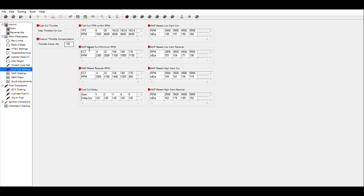Our fuel cut settings — we're going to change this from 100 to zero. What happens is when you lift your foot off the gas pedal, sometimes the car keeps it at an RPM for a certain amount of time before cutting the fuel. We're going to change that to zero so it gets a nice clean cut. We're also going to change the timing — this is the delay between lifting your foot off the pedal and the fuel cut, in milliseconds. We're going to drop this down.